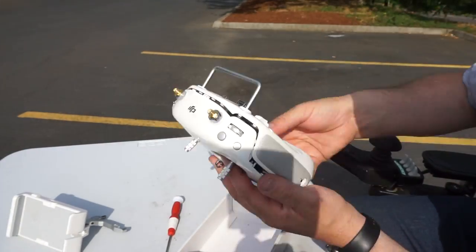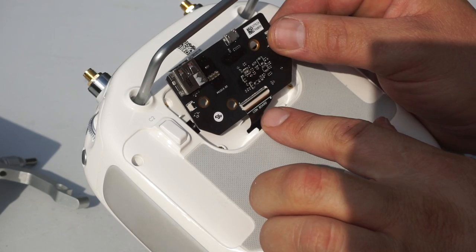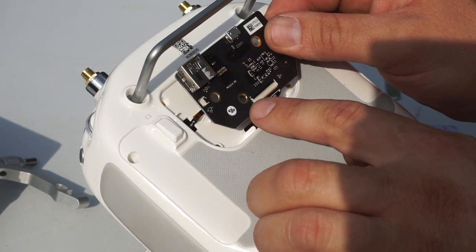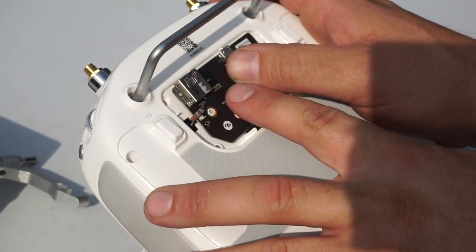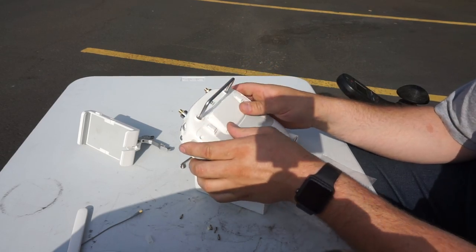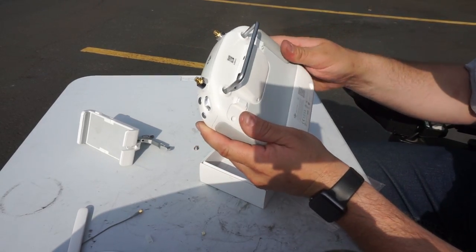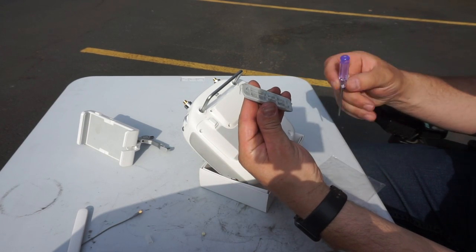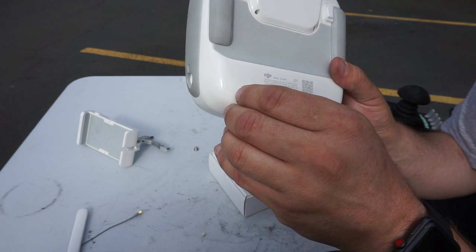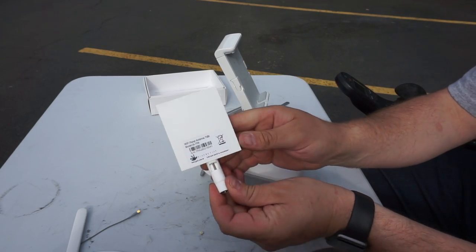You can tell the ribbon cable is in place because there's a little white line that lines up with the edge of the connector — just fold it down, there we go, locked in place. Then put the screws back in and reattach the other two little ribbon cables. Looks like our glue is still somewhat serviceable. This other one got a little bit peeled off, so I'll try to reposition it. The plugs here on the bottom are keyed — there's a little notch on the plug and also on the controller, so just line that up and the glue should hold it back in place.